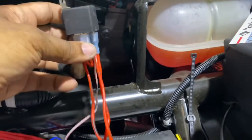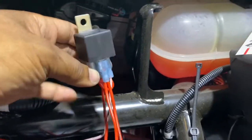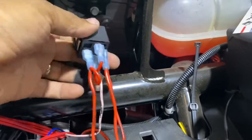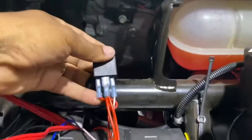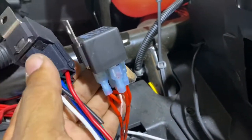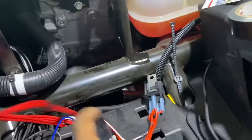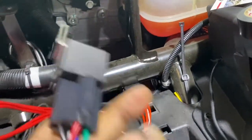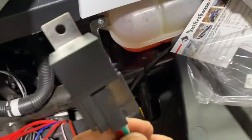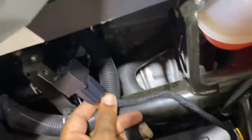Especially on a Slingshot where it's a pain to take the dash out — you have to take a whole bunch of stuff out just to get to the radio. Also, why would you put female spades on a relay when you can use a relay socket? With a relay socket you don't have to worry about the female spades falling out, or someone taking it off and not remembering the order to put them back. Wrong way to do it, right way to do it — now it's serviceable, the pins won't come out, and it can get mounted right out of the way.